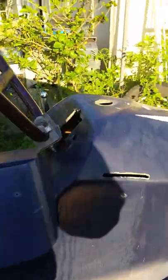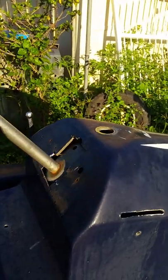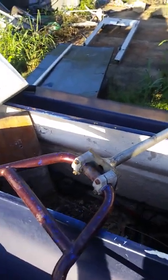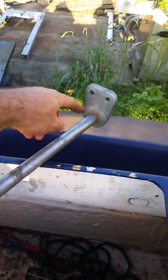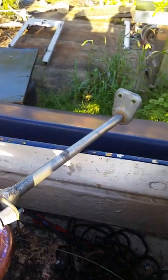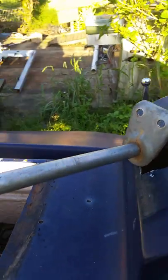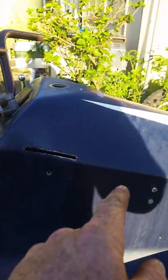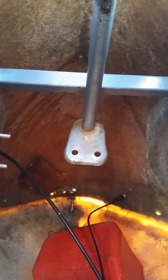Revised part two - I've got the steering bar sitting in there now so you can see the steering together. I'm actually gonna have to shorten this down, but this piece in here is only plug welded in, so I can just grind the end off and shorten it to what I want and weld it back in again. Instead of trying to put a bar from over here through and back up, you can see there's two bolts here, same on the other side - I've bolted a bar between the two which I can hang the bottom off.